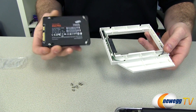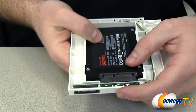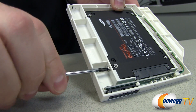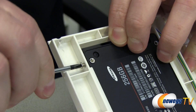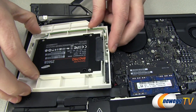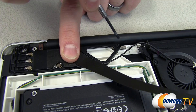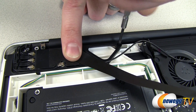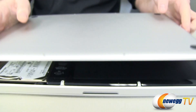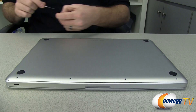Next, install the SSD into the hard drive caddy by sliding it into the serial ATA connectors. Partially mount with screws, as this is a temporary solution — we'll be coming back to swap the drives once we copy the image. Finally, install the caddy into the Mac and connect the SSD to the serial ATA connectors. Mount the three Torx screws, set the antenna cables in place with the two Phillips head screws, reconnect the camera cable, optical drive connector, and battery, then partially remount the backplate.